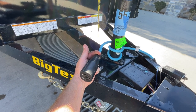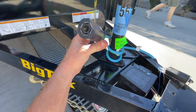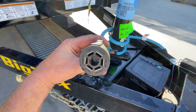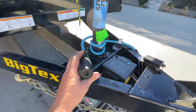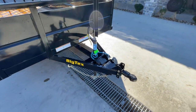It's got a sealed wiring harness — a cold-weather wiring harness, which is why it would be blue. It stays flexible to negative 65 degrees. It's also got a 7-RV blade-style plug, which is standard in the trailer industry and pretty much what's on all trucks. You'll notice on the end of the plug it does have color codes, which is nice — one of the first harnesses I've seen do that in the industry.